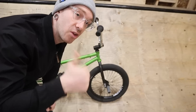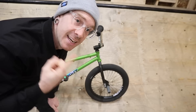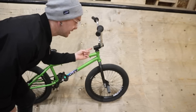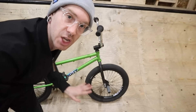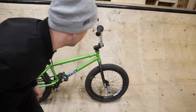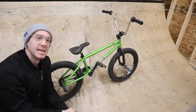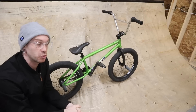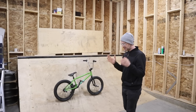If you've got yourself a fixed gear frame, you still have to worry about steer tube length, so you're going to have to cut that and install a star nut. On a BMX these are already threaded — the top caps go with the fork, too easy, no extra tools required. Also, every fixed gear frame is going to have a threaded bottom bracket, which means some sort of special tool depending on what crank and bottom bracket you go with.